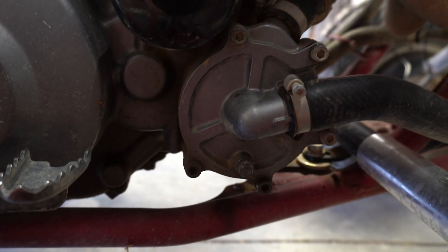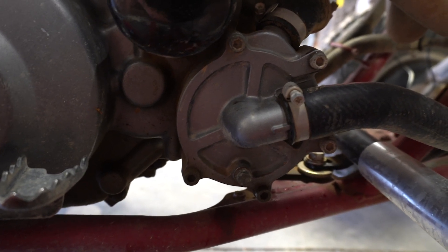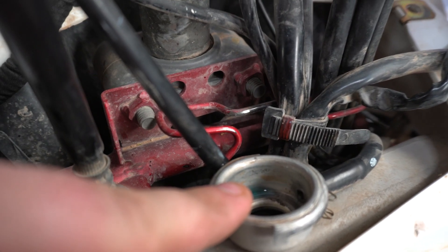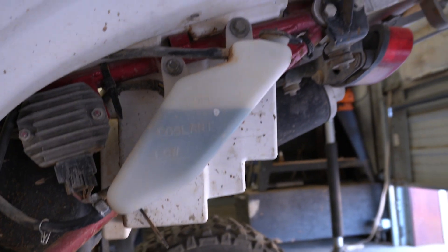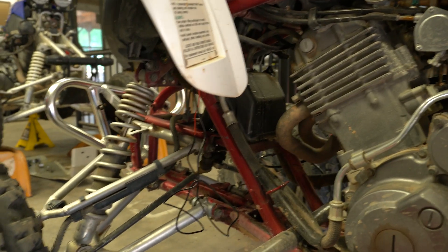The connections are made and it really flows in with the bike nicely. The wire is wrapped and tucked behind the gas tank. Now put your water pump drain plug back in — take that 8-millimeter and torque it down to 88 inch-pounds. Once that's done, start refilling the coolant right at the bottom of your radiator cap. Run the bike for about a minute, let it cool for a minute, remove the radiator cap and top it off. Fill your reserve tank to the full line and the bike is ready to go.